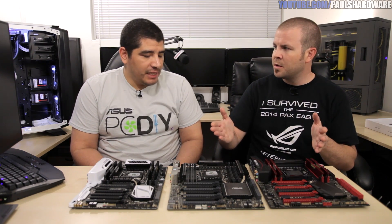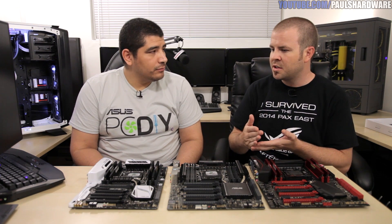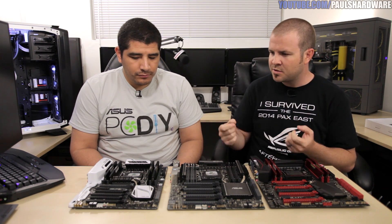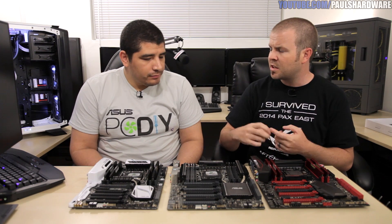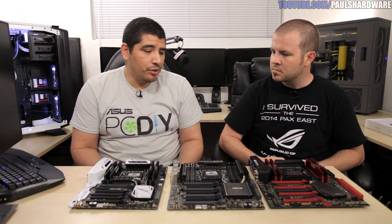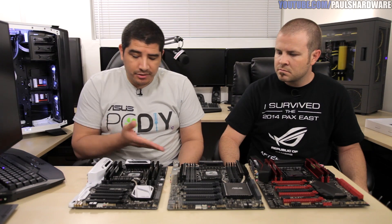The enthusiast platform from Intel has always had a long lifespan, but X79 is now so old that many features introduced with Sandy Bridge, Ivy Bridge, and Haswell are features we're only now able to take advantage of. One example is the IRST update enabling Smart Response Technology — something we saw with Z68. Storage on X99 is truly enthusiast class. DDR4 also complements storage in interesting ways, because the density, frequency, and bandwidth available make RAM caches and RAM disks really exciting.